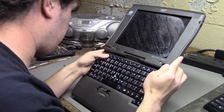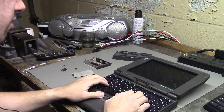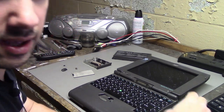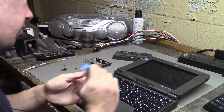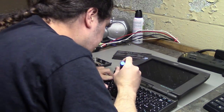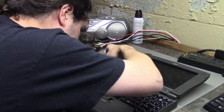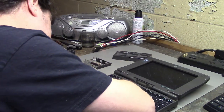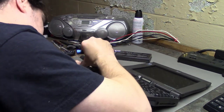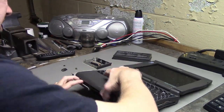Let's try to get the keyboard off. I think I have to pry something under the keyboard to get it off — I think it's clipped on. A lot of laptop keyboards are just clipped on to the case. I think there might be little tabs underneath, or maybe I can just pry it off. Oh wait — I guess I just had to be a little forceful and snap.